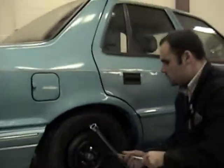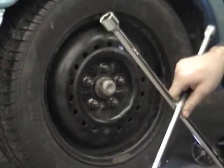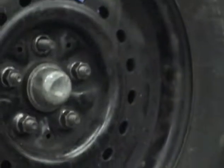Now I can continue loosening and removing the wheel nuts. Notice that the wheel nuts came out with the tapered side facing the wheel. Most students forget this and reinstall them with the tapered side out, thinking it's more aerodynamic — that's not the case. The wheel nuts don't encounter wind because a hubcap covers them. I'm placing my wheel nuts in a nuts and bolts cup so I don't lose them — nuts on the floor can be kicked into a sewer and lost.